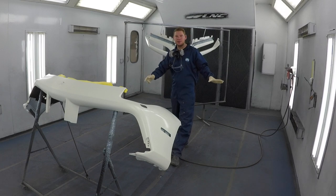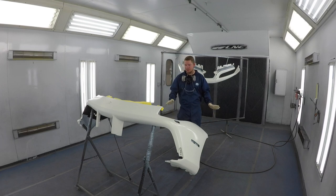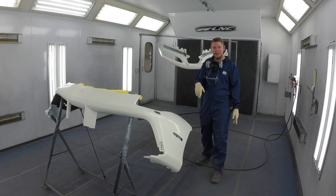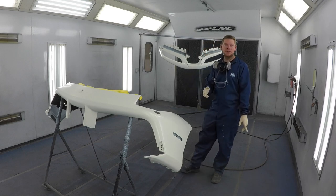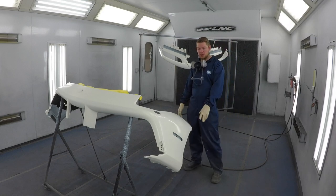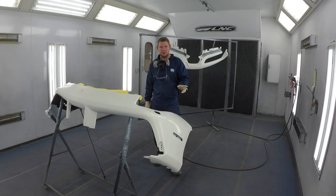I want to keep this job clean, try not to move the camera around too much to get any extra dirt in my paint. I'm going to do my two coats. One thing with white colors — the clear just has a yellowish tint to it. So when you clear-blend panels on white cars, you have to be careful with the edges. I typically do one coat on the very edge so I can avoid the buildup of clear and making it a little yellower than it should be. That's why I'm going to stay away from the edges on my first coat. Second coat, I'm going to go over the entire thing.